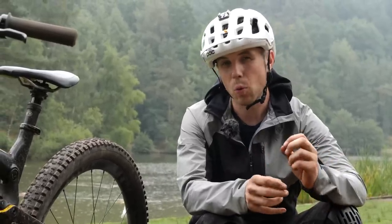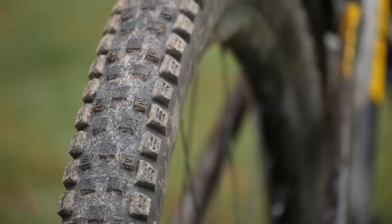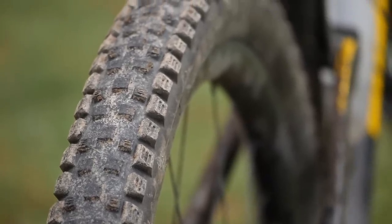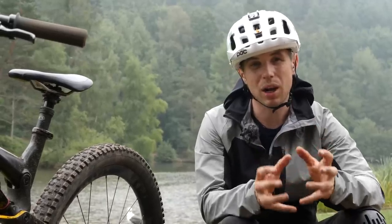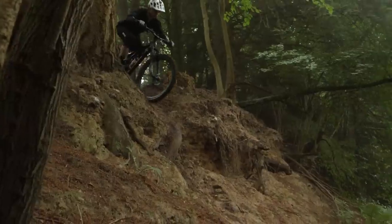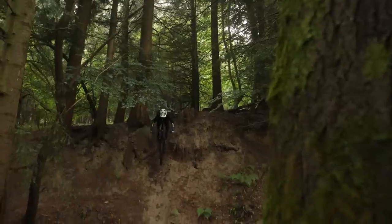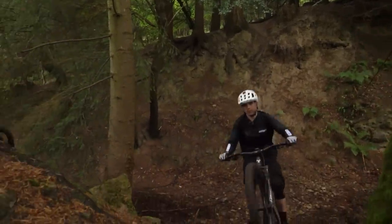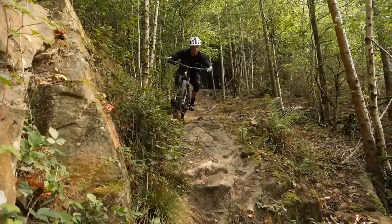With the ongoing conversation about wider rims, how important is that to your everyday trail rider? For me, in my personal opinion and experience, reasonably so. I think for an aggressive trail bike such as this, with quite an aggressive tire with a big shoulder on it, I would tend to lean to the slightly wider side of things. The stability is absolutely massive, especially when you're pushing load through the bike. A big one as well means I can get the supple feeling of lower pressures thanks to a larger contact patch, without having problems should the terrain get a bit choppy. I know from my personal experience that if I do run lower pressures — anything sub 28 — on what would be a more old school or narrow rim, I'm going to be burping and puncturing, damaging the tire, which not only hurts my ride but hurts my wallet too. Both things have to be carefully managed. It's also worth noting that we haven't even got into climbing today and all the traction benefits that are to be had from running lower pressures there.